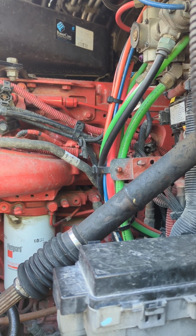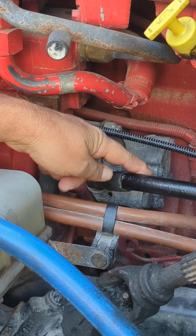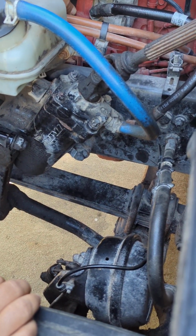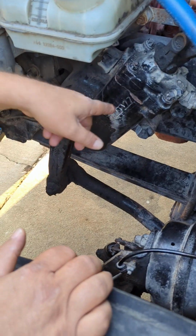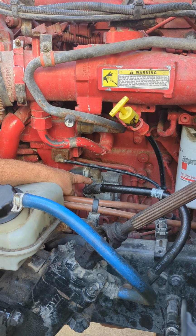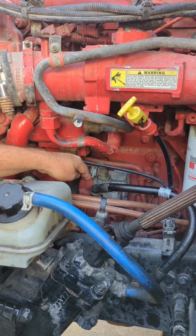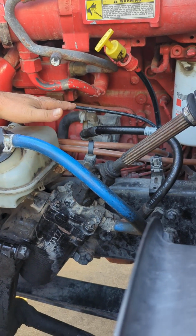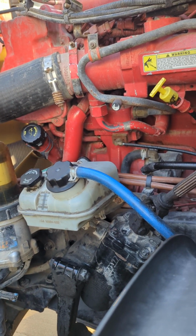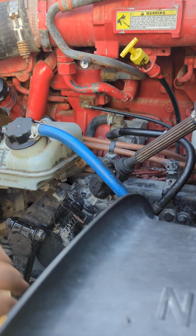Okay. Now right next to it is my power steering pump, and the hose is going to the pump and the gearbox. So where's the gearbox? Right here. So the power steering pump is properly mounted and secured, not cracked, bent, or broken. It's gear driven. It's also not leaking. Okay, now I'm going to do my 3 hoses. I'm grouping them together. When I'm doing this, I'm doing all the power steering parts in one shot. So you get it over with, it's done, you don't forget any part.